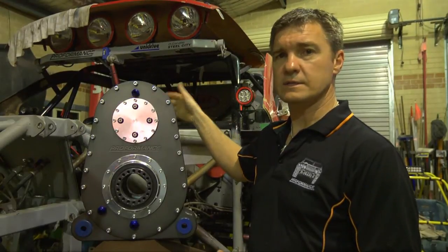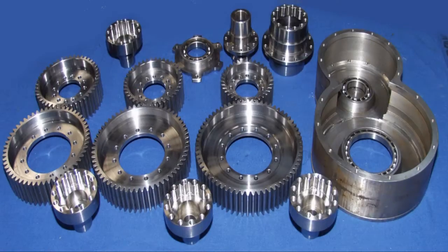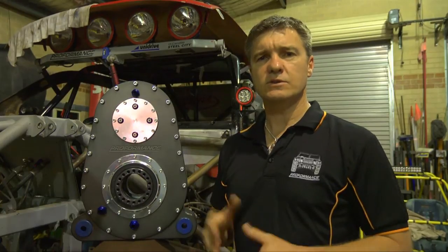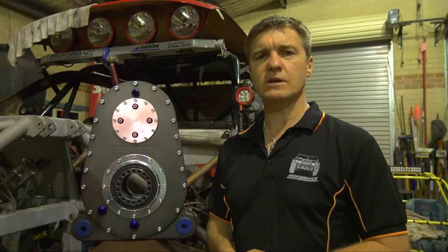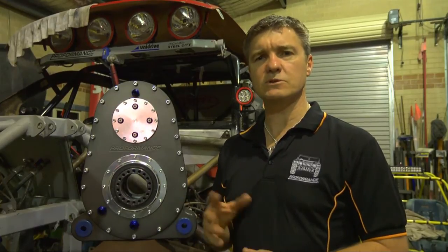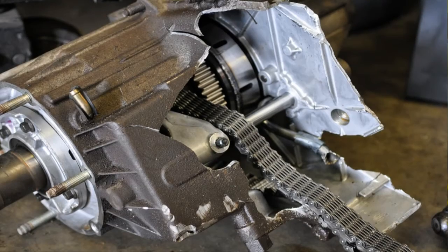Our racetrack behind me here actually has three different gear ratios. We have top speeds of 140, 180 and 220 kilometres an hour and we change the ratios of the transfer case depending on the terrain we're driving on and the track that we're competing in. There's no point in having a vehicle that can do 200 kilometres an hour if the highest speed on the track you can achieve is 160 for that particular day. The idea is to put in the ratio where you can achieve maximum RPM in top gear at any part of the track.